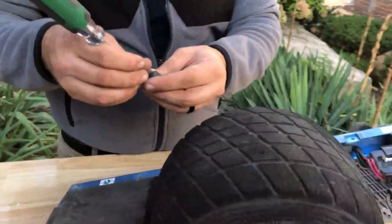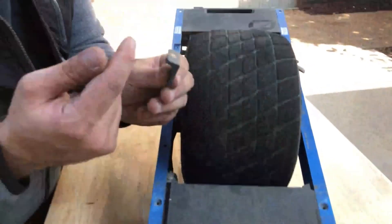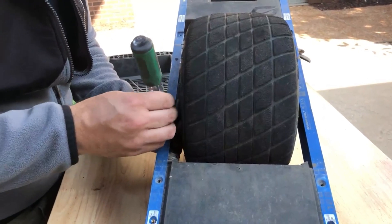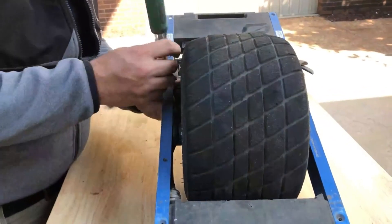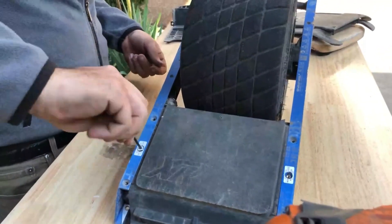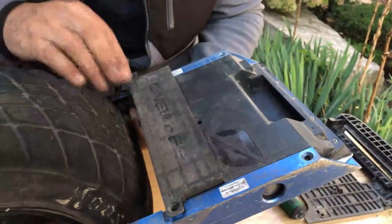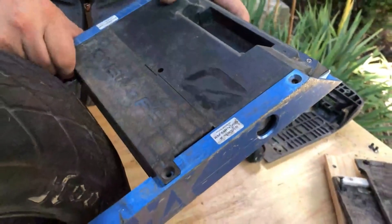Take the rest of the harness covers — they are shaped like an L, and you want the chamfer to be at the base of the L. Once you position it and can see where the insert is, hand tighten the screws; they'll straighten out once you get some torque. Don't over-tighten these because you will strip them. Now grab the warranty void screws and put those back in place so the housing is secured to the rails. Then take the wire cover and put that back in place, making sure the tab folds in so it doesn't fall out.